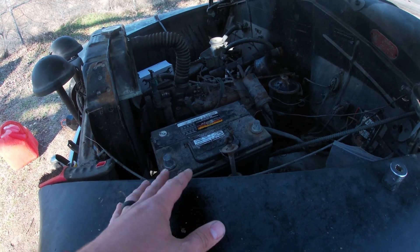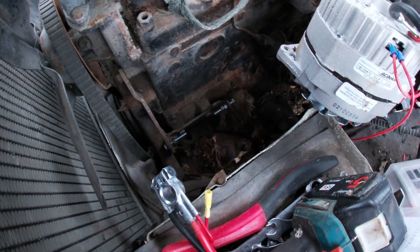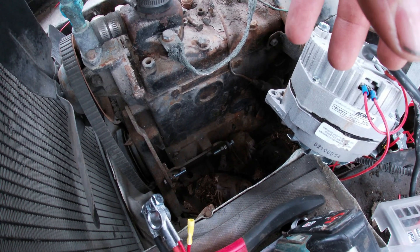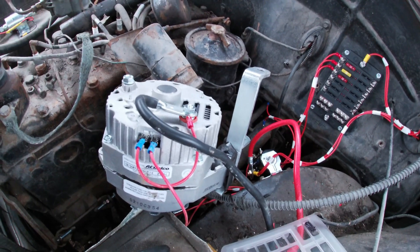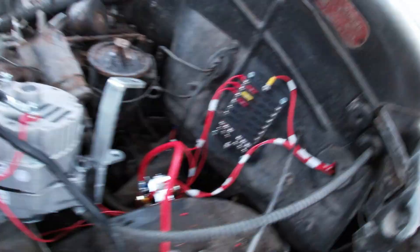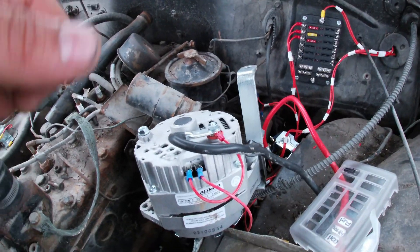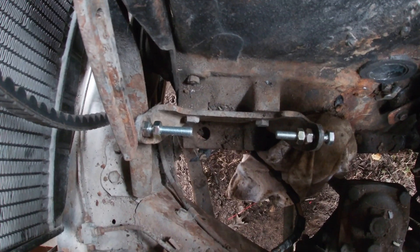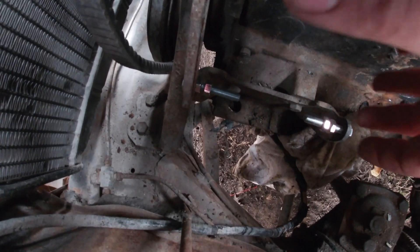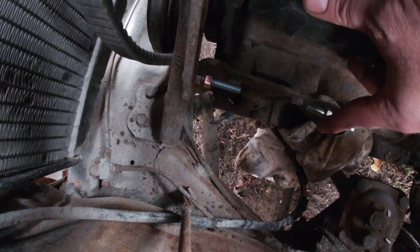You could wire one of these in one day. The first thing you need to do is remove your generator — you can actually sell that and recoup some of your money. I got lucky and had an old Ford tractor conversion kit that came with a bracket I didn't need — it's a bracket for a 1950s Ford 8N tractor and it just bolts straight down where the generator was mounted. I took two bolts, one on each side, slid the new mount on there, and then adjusted the nuts to push out and tighten the alternator down.